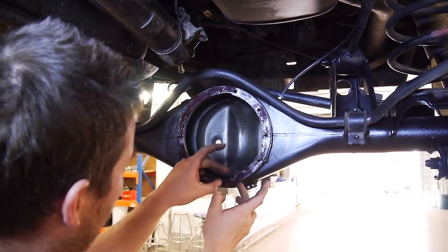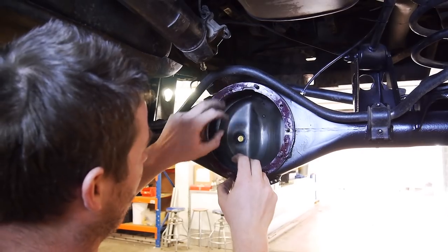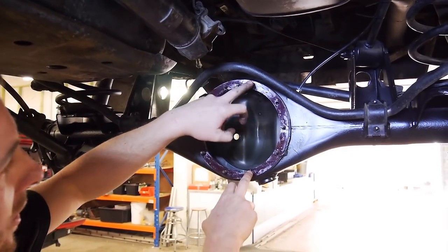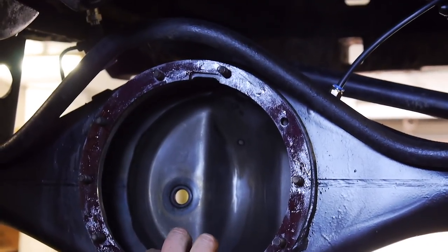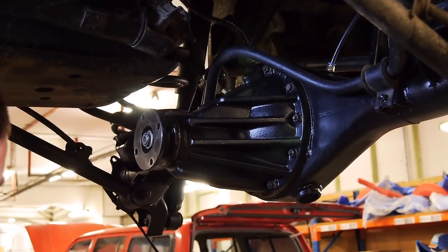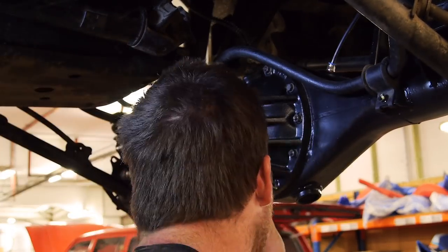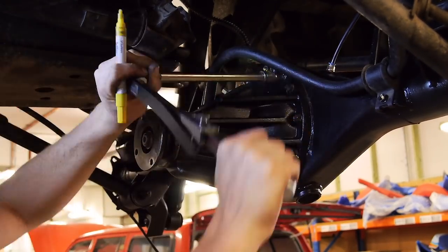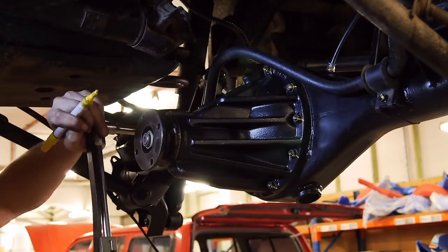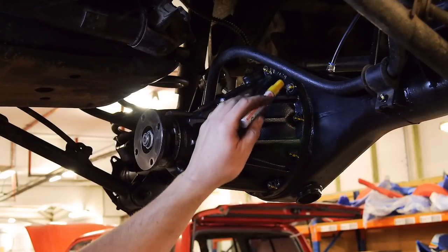Right. And also another pointer, if you've taken your studs out to clean this mounting face, which I did, the two longer studs go as you're looking at the thing on the top right and bottom right, basically, next to those little cutouts. So these are torqued to 47 Newton meters. Guys, that's it. And as you saw, marking them with a paint marker, both shows they're done, and also I can see if they ever move.